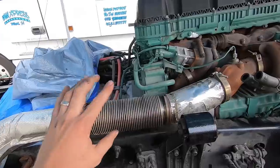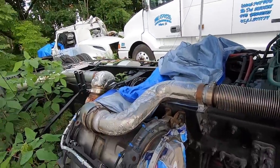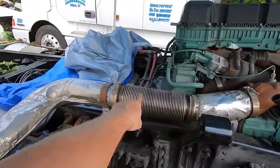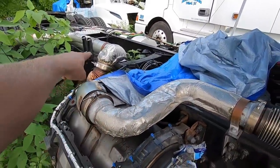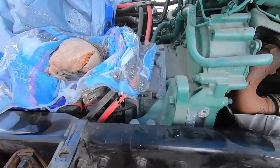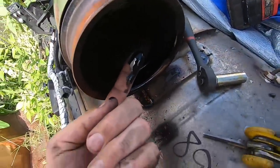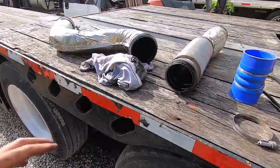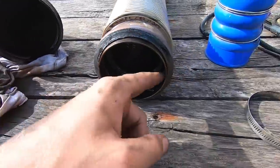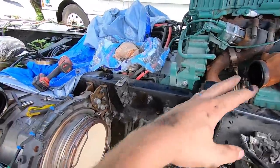If there's a lot of oil, I'm going to clean it out. It's not a big deal — it's just because it was upside down, the oil seals leaked and went through the exhaust. It usually burns everything off and should be good to go. I just don't want it to get to the DPF filter. Surprise, surprise — there is oil right there. I took off the other side and there's oil there too. It's filled with oil — not as bad as I thought, but the actual inlets are full. I'm just going to clean them out with brake cleaner and it'll burn off whatever's left.